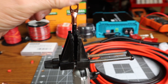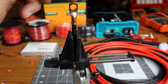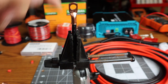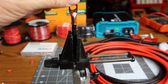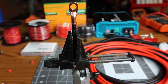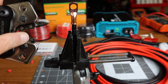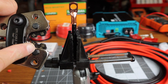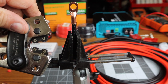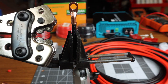To make this a little easier, I mounted the wire into a vise and put the ring terminal on. This way I can hold onto the wire — I don't want the ring terminal slipping. I want a complete crimp on the wire. I have it set; the jaw is set to 10-millimeter, which according to the directions is the right size for 8-gauge wire. I'll put links to these crimpers and cutters in the description section of this video.